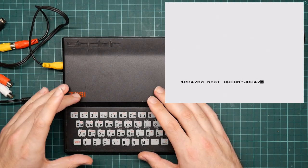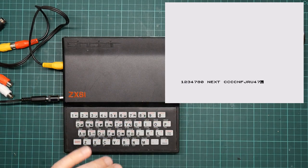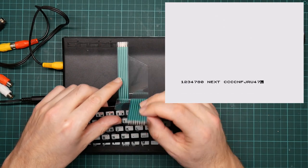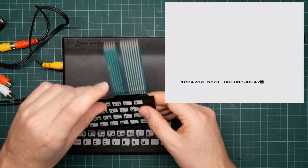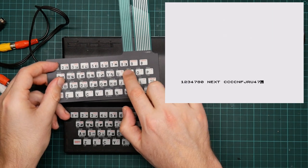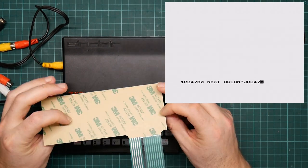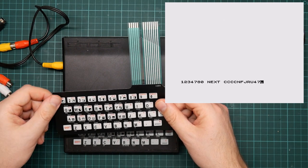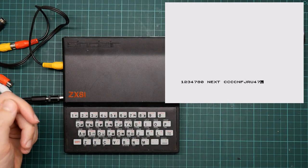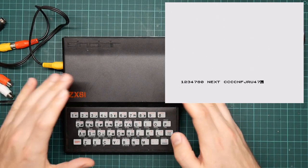The way these keyboards work is they divide the keyboard into rows and columns. You can in fact see that there are two cables here — one which connects to the top of the keyboard membrane, the other which connects to the bottom. When you press one of these buttons it touches the two together, so one of these traces will have failed. It's probably repairable if I had some conductive paint, but I can't be bothered, so I'm just going to put a new one in. Repairing them is a fool's game anyway, because once they go they just go.